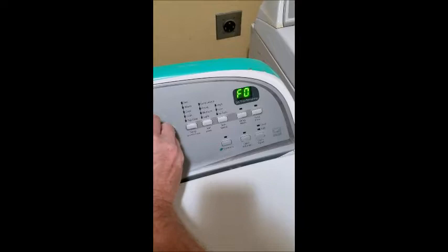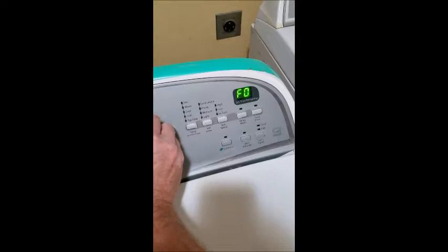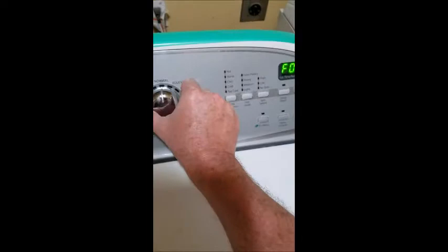Once done, turn off the power, then turn the power back on. Go around the horn back to Normal, then counterclockwise one, two, three, one back, one forward — then you'll see CL. All right, it's clear now. That other code that was on the fifth cycle — it's clear now. Good, we've confirmed the codes are cleared. Now we need to begin diagnostics.